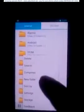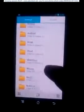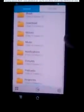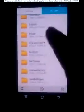First of all, you have to download the upgrade file from the website. When the download is complete, you have to copy your upgrade file to your SD card. You also have to unzip this file and copy the dload folder to your SD card root folder, or you can make a new folder on your SD card root folder and then copy your upgrade file. The file is called update.app.